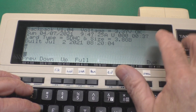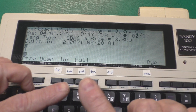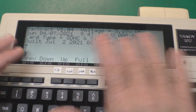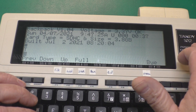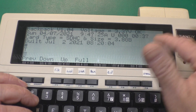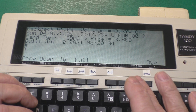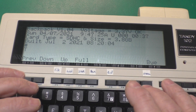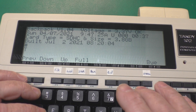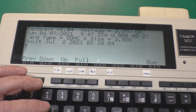If you're using the backpack with a Tandy WP2, you'll need to put it in WP2 mode because it speaks a slightly different dialect. You can do that from the CLI — that's nice and easy. If you were to bring it back to a 102, you would just put it back in the standard mode. And there's also a third mode for use with CP/M that allows you to use the larger CP/M files. So you just need to make sure that your mode matches how you're using it.